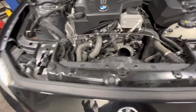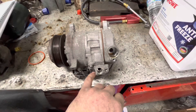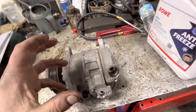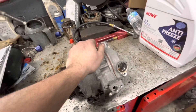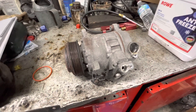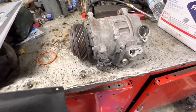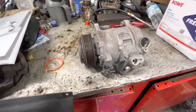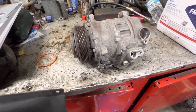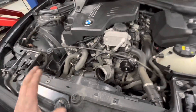When you're adding oil to something like this — here's the old AC compressor — what they want you to do is drain the refrigerant oil into a container, measure how much comes out of the old one, and add that quantity to the new one. That works perfectly fine in a perfect world, if the system never had a leak, was always charged correctly, and the right amount of oil was added back after every evac and recharge.